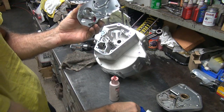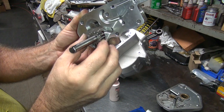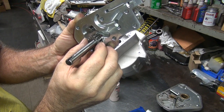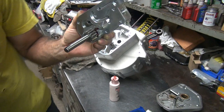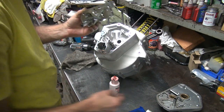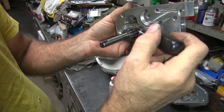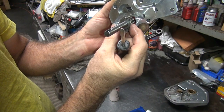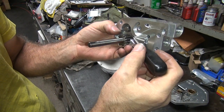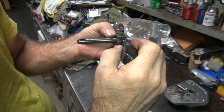Like that. That'll lubricate the gear when you shove it all the way in there. So you got two gears, one without a key, one with a key, and this is a tall gear. Okay, now you gotta kind of eyeball it and shove this in there. Try to feel as you go. Not feeling the keys pushing up, see? Take your little small screwdriver. Push it back in there. I'll try it again. I'm still not feeling it, but you take your screwdriver and hold the key down on the back side. You try to rotate it and find a sweet spot and shove it in.